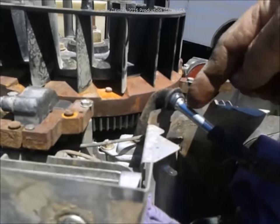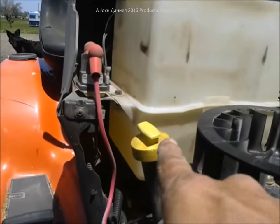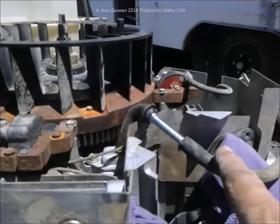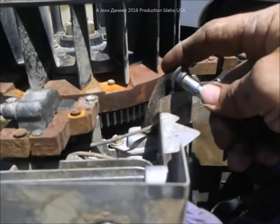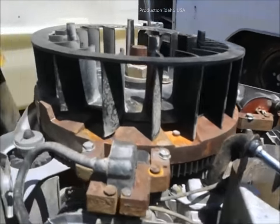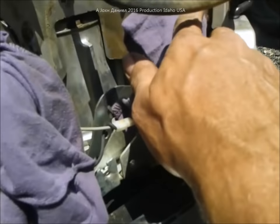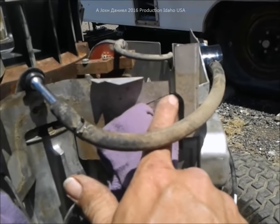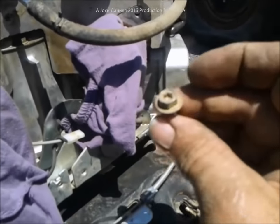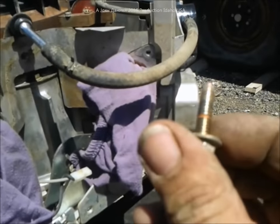I used a 1/4 inch extension to put into the fuel line because it'll continue to drip as long as your tank is higher than this. Stuff the other end — the driver end — into your PCV line, the positive crankcase ventilation line that runs back up to your carburetor. These fasteners are T30 Torx and 3/8 nut — T30 Torx — there are four of them, and they do have some lock on them, so you want to put some Loctite back on them when they go back in.